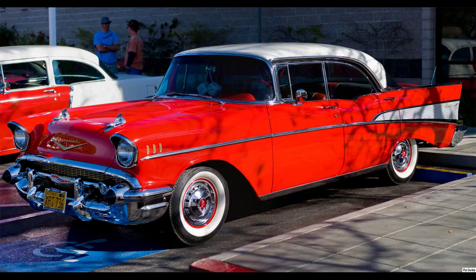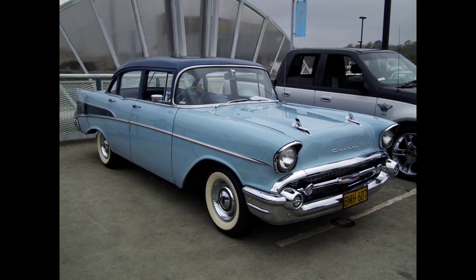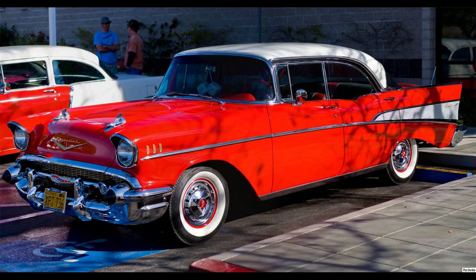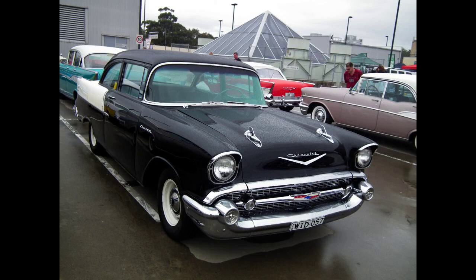The 1957 radio used tubes that required only 12 volts of plate voltage and a transistor for the output stage, lowering the power drain on the battery to an insignificant amount when the engine was off. Playing the radio with conventional tubes for extended periods occasionally drained the battery to the extent that it could not start the car. The clock was electrically self-wound, and moving the hands to correct the time resulted in actually regulating the going rate; after a few corrections, the clock was remarkably accurate. Another dashboard-mounted item was the traffic light viewer, a ribbed plastic visor installed just above the speedometer, which captured the reflection of overhead traffic lights so the driver didn't have to lean forward to see past the edge of the roof.